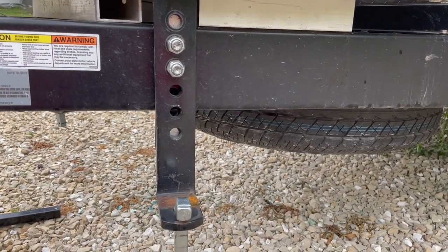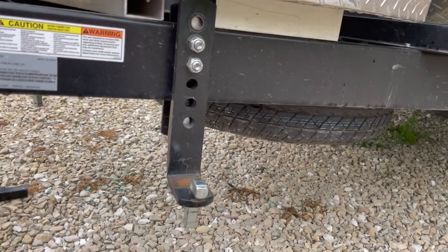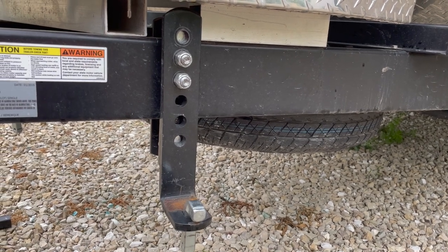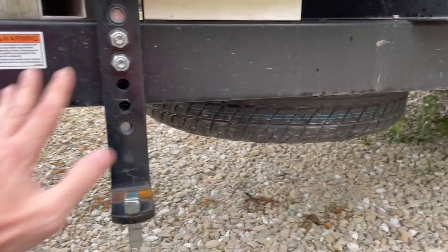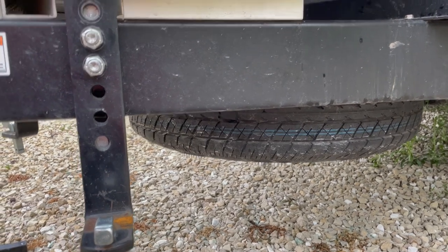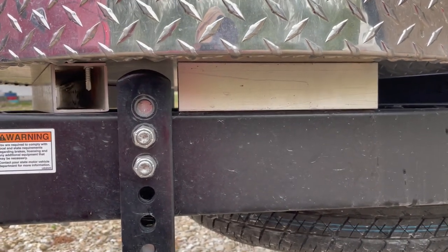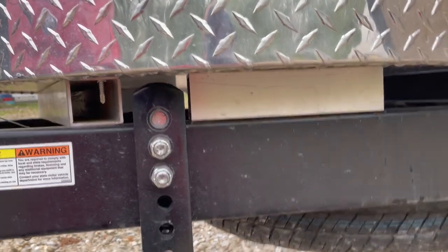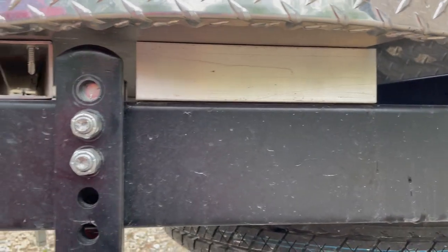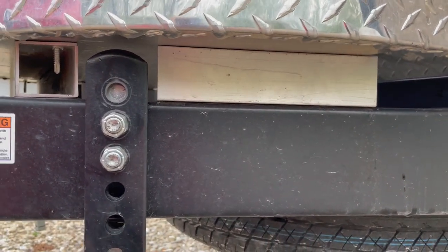What you see right here is the mounting bracket. Because the tongue weight on the Tab 400 is 465 pounds, I had to go with the 400 to 600 pound version of the weight distribution hitch. The bigger the weight distribution hitch, the farther back you have to have the mounting bracket. That's a problem because the mounting bracket went above the frame right here, which meant my tub did not fit appropriately. I couldn't put the mounting brackets on without doing something with the tub. These are aluminum square pipes — I had to actually raise the tub in order for the mounting brackets to fit.